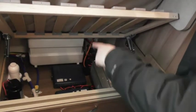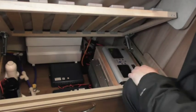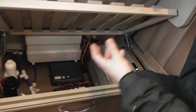If there is any residual water and it freezes, it can move along the pipes down, so just leave everything open. The two blue boxes are obviously for your motor movers. Don't cram it too full in here, because electrics do need a little bit of air to breathe, otherwise they'll overheat. So don't stuff this full as you can.